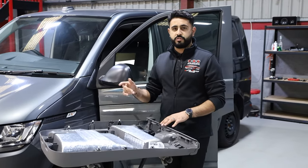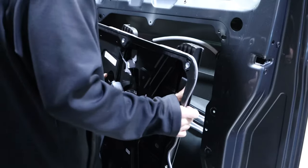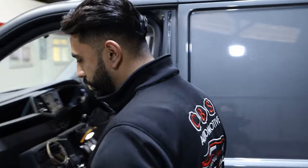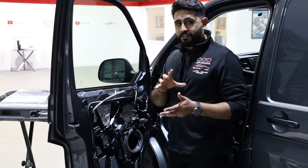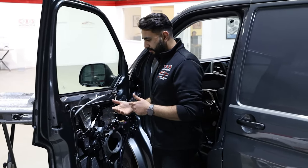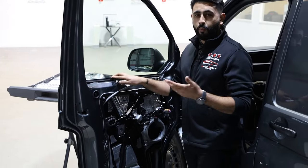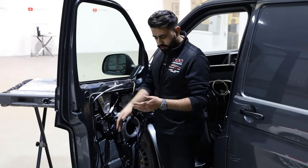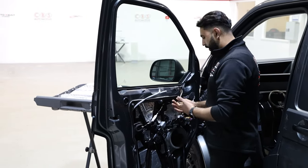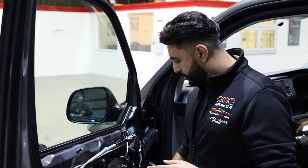The 3mm Skins layer makes any panel really, really solid. They have changed the design on the T6.1 compared to the T5, so it's a bit of a different structure in terms of the speaker location and the interior design — all of that is being acoustically soundproofed. Moving inside the vehicle, soundproofing is a really important part that a lot of people overlook. You can see this plate that sits all the way around — it's like a weather shield because on these T6.1s these are what's called wet doors, where water comes down and drips through the bottom.